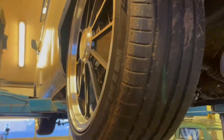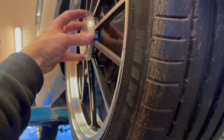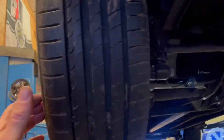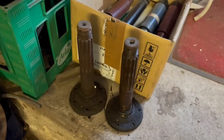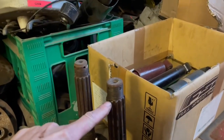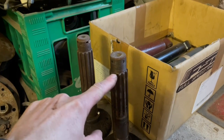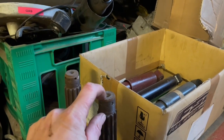I'm getting older and don't want to go super slammed anymore. When we're here — if you're using aftermarket wheels like I do, it could be almost any aftermarket wheel — if you have an early bay you would have a problem with your axle going through and you cannot have your center caps on. So if you take an axle from a late bay, the threads will stop here so you don't have it protruding through the rear drum.